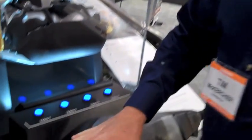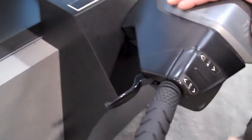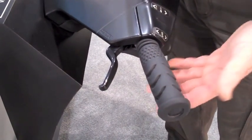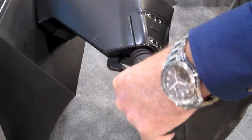With the fly-by-wire system, we are able to get rid of the large reverse handle and actually integrate it into the handlebar. It's very similar to a snowmobile, a bicycle, or a lot of different vehicles that have the brake lever on the handlebars. Now, simply pulling in the lever overrides any throttle input.